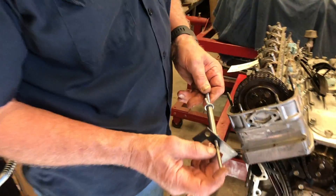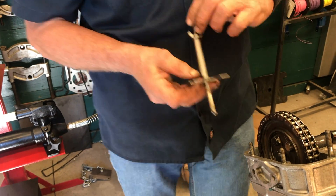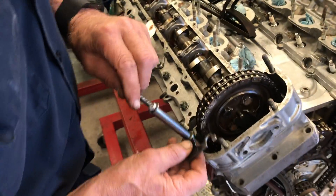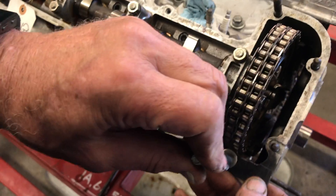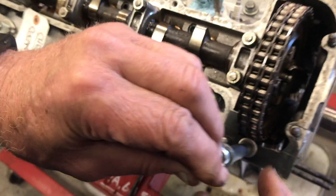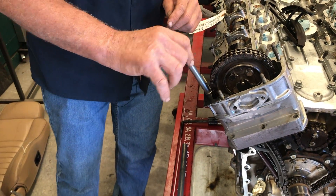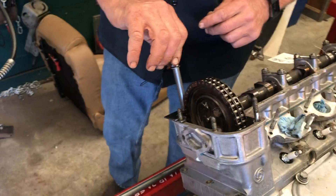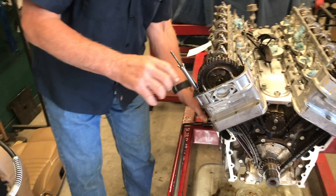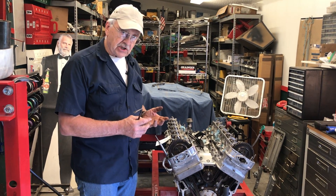You still have the hook down here, but instead of a big lever, you hook the tensioner with it, then slide this plate over the gasket flange on the cylinder head and use this wing nut to slowly tension the tensioner. So with the tool installed, the hook in place, and tension on the timing chain tensioner, we're ready for the next step.